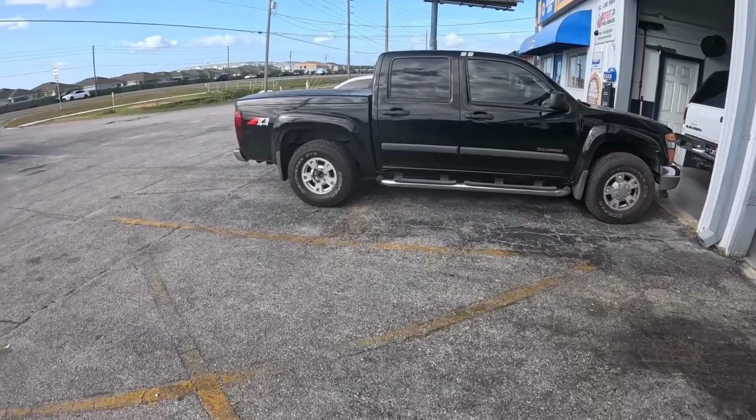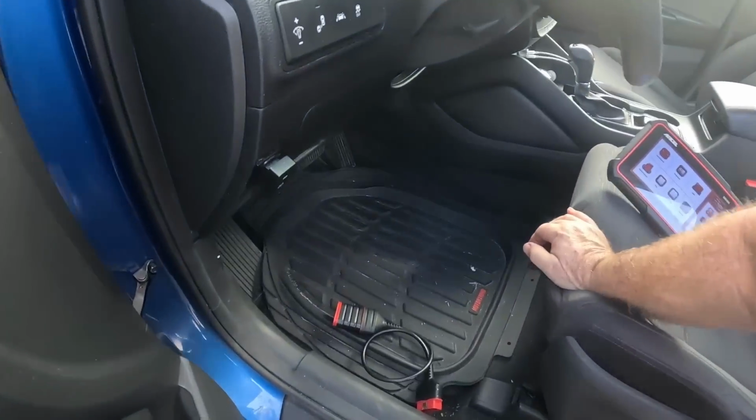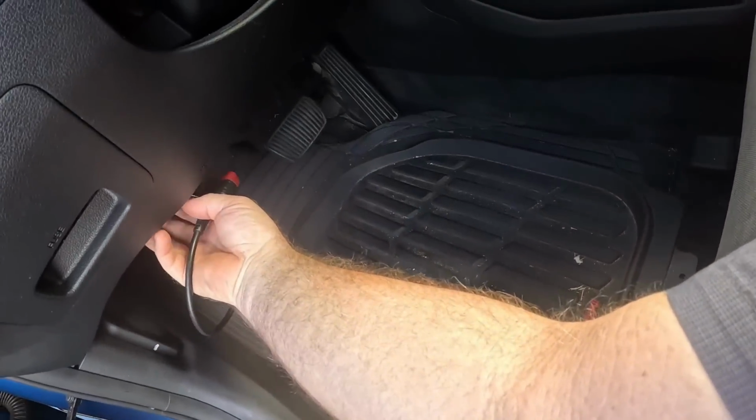See, I told you the wheel's back on. I had to bend the backing plate out of the way. The drum wouldn't go on all the way because it was bent a little worse than I thought, and it's way stiffer than you might expect.